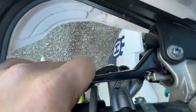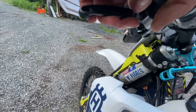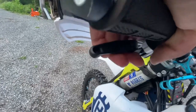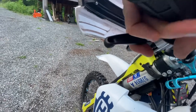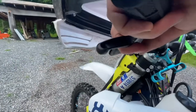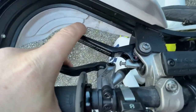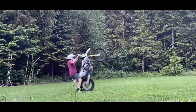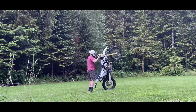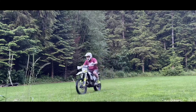When you pull this, you can see the finger right here — the pointy finger is just underneath — so the brake will not pinch this finger. I can put huge pressure here and still have clutch. I really like this. I was just doing slow wheelie training and pivot turns. So here's a pivot turn: I come up and I can hit the rear brake with the left hand. Now I'm using the clutch and the brake to move it along — all left hand. It's awesome. I can't believe it works really well.